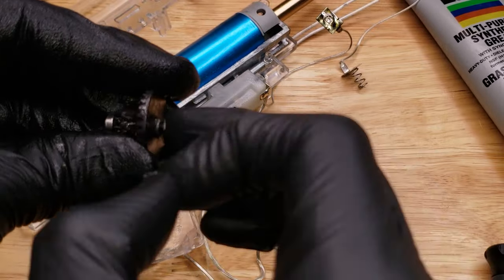So I'm going to replace that 0.4 with a 1.2 shim on the bottom for clearance from the housing, then 1.2 on the top. So it allows a little bit more clearance from the bevel gear. So there's still some clearance from the plastic housing now. And let's see if the clearance from the bevel gear has improved. Because before it was pushing down on it. Let's see how freely this spins. It seems to be pretty good. I don't hear any rubbing or friction. Okay, so that motor spur gear engagement feels better now. So I'm ready to put everything back together.